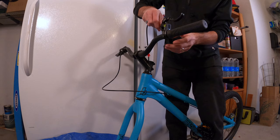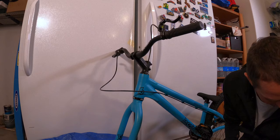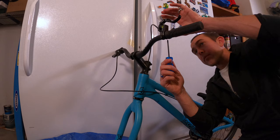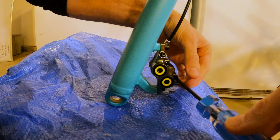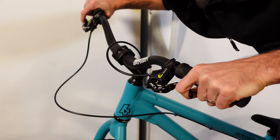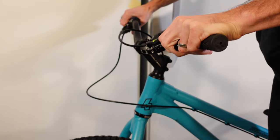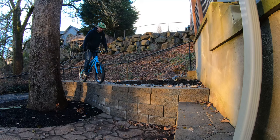Carefully reinsert the hydraulic line into the brake and tighten down the bolt. Whatever you do, do not squeeze the lever here — without the pads and rotor in place, you're going to have a bad time. If you made it this far without any issues, you are in the home stretch. Flip the lever back down to its normal position and reinstall the disc brake pads and front wheel. Once you have everything reinstalled and tightened, go ahead and cycle the lever to recirculate the brake fluid throughout the system. If you did it right, you should feel the brake grabbing like normal. If you lost fluid, you'll notice that the lever is coming in closer to the bar than normal. In that instance, you're going to need to do a full bleed of the brake line — not the end of the world, and definitely a bit easier than rerouting the line.